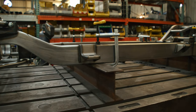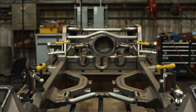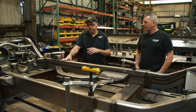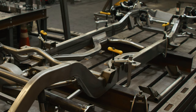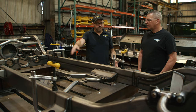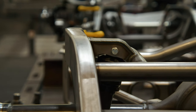So let's move on down the chassis here and see some of the other details. Obviously this one has some more structure over what the original C10 chassis would have — the internal bracing, the X member, the rear cross member with the half drive shaft loop in there, exhaust pass-throughs — a lot of features to make this more structural. There's a lot that goes into that in terms of stress analysis on the frames, on where to place the cross members. It's really not random. A lot of thought goes into where to place the cross members. Clearances have to be considered — how are you going to run exhaust through the chassis, how are you going to mount transmission cross members, things like that. The first and foremost thing is always structure.